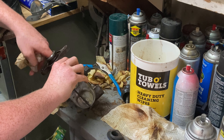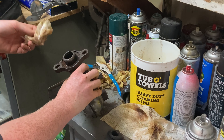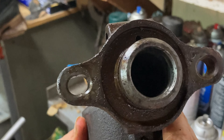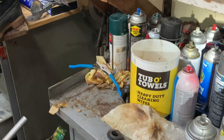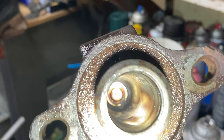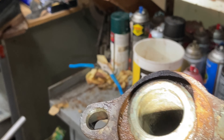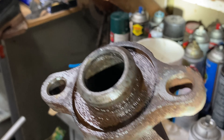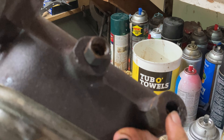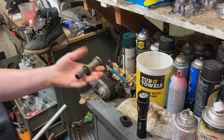This is actually a little rough — it's good on the top side but there's definitely ridges. You can see down in there. Now you can see the corrosion there, and see how smooth that top is. Those little rings of corrosion — that's what stops the spring from returning, which will stop you from getting pressure to one of these two lines.